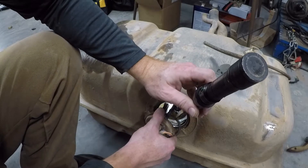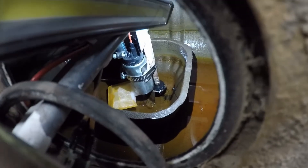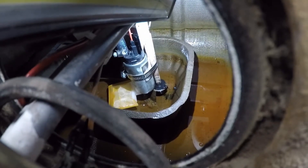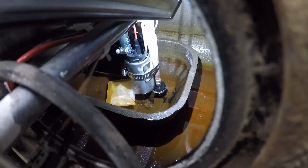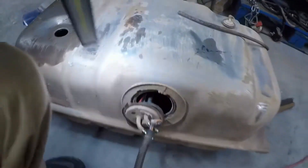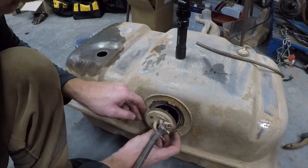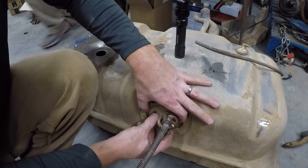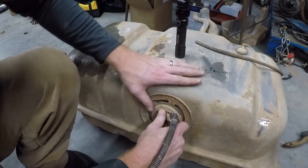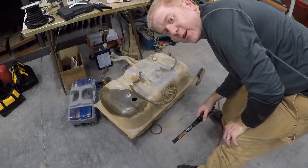You have to carefully get the little rubber cone on the bottom of the return line into a little pocket. You can see right in there where that cone goes into the receptacle in that little slosh pan, and you can see how the whole thing sits in there. That's how you get your fuel sending unit in there. Then once you have that done, you can go ahead and get your O-ring in position and get that seated in there. This fuel tank is ready to go back in the truck.